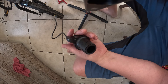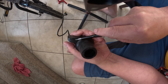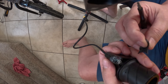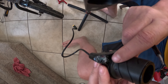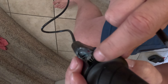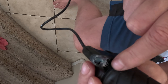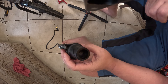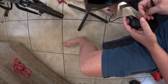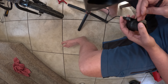There are two ways to fix the wiring issue. One way is to fix it on the throttle itself — there's usually a screw right there and they're pretty much all built the same. Once you pop that little door off you'll see three wires for the hall sensor. On the two upper ends you'll see a black and a green wire, or black and whatever color they used. After you swap those wires it'll work great on the DYU A1F. The other way will void your warranty — you can actually change the wiring at your controller.